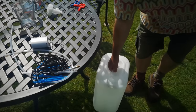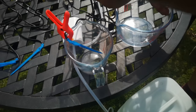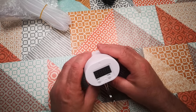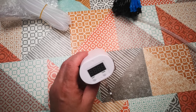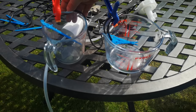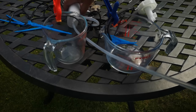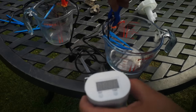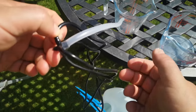I took this outside for a test — I was going to test it with four nozzles, then with eight, putting one nozzle in a smaller jug and three nozzles in the larger jug to see if the water distribution was even. Unfortunately I ended up killing it, and it's my fault but I think it's an easy mistake to make. I connected it with a piece of tubing going down into a 40-litre water tank, then connected the output hose to the four-way splitter going off to the four nozzles, set it for daily at 30 seconds. Unfortunately there was a kink in the output hose.